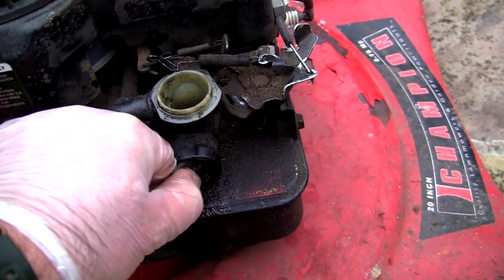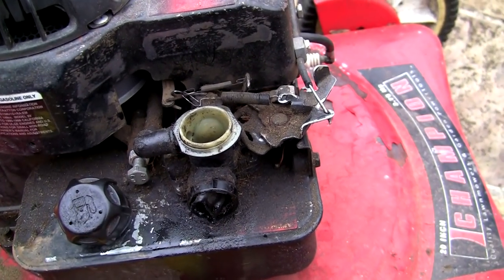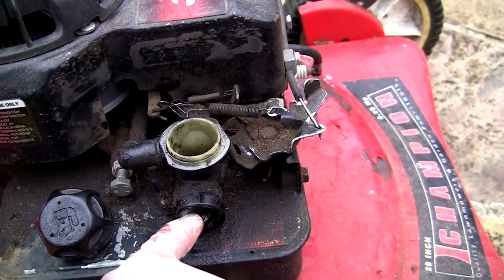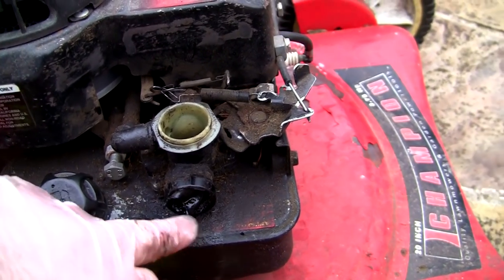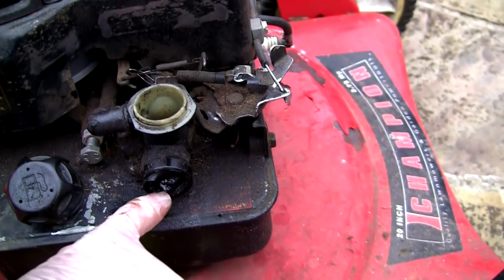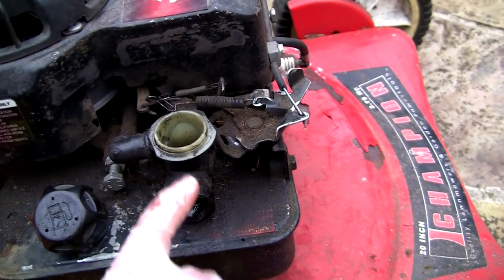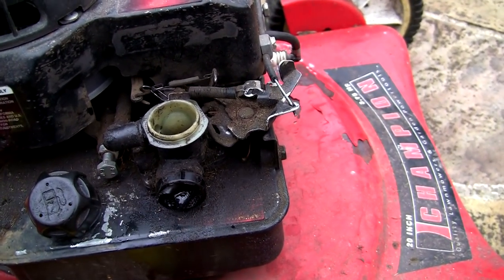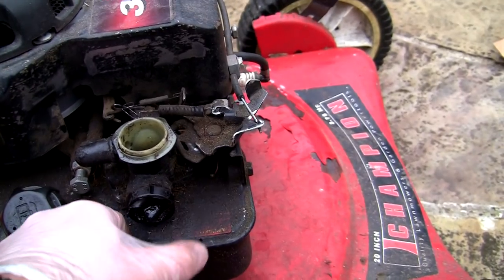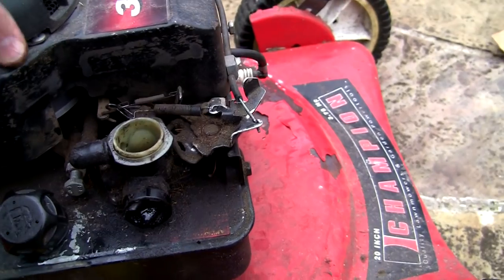Don't ever buy aftermarket parts like this by the way. You get these parts and think because it's only a primer bulb it'll be alright, but they're not designed to be stored in cold temperatures. It's freezing in garages like this for months on end and they just don't last. You can see this has just perished — it's no good whatsoever. The question for me now is whether I've got a spare primer bulb. I'll have a look in my box in the garage, and if I have I'll swap this over. This throttle doesn't work either — this cable doesn't work.